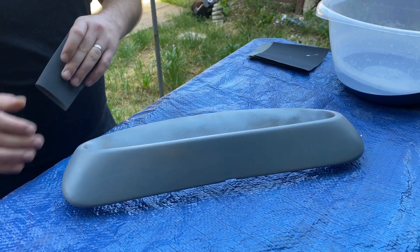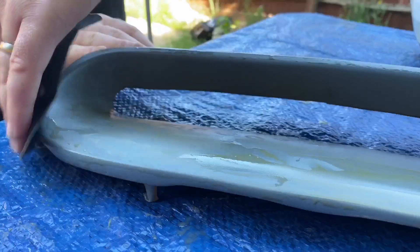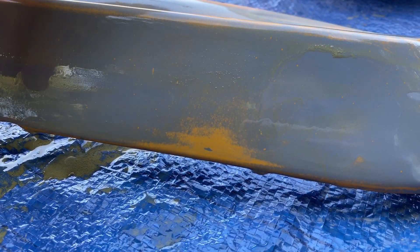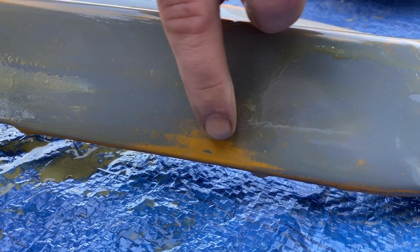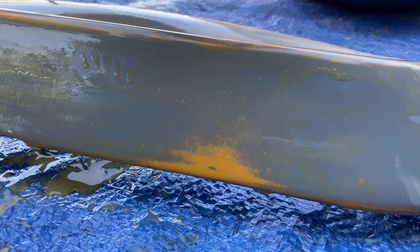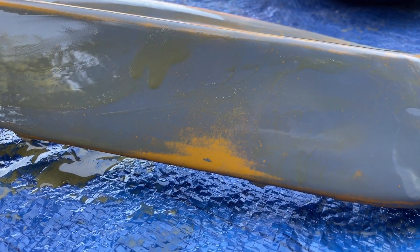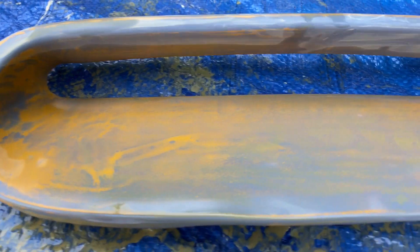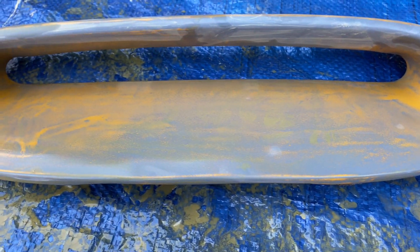You can see now why I've done a grey layer, then the yellow layer, then another grey over the top. Now I've sanded it down, that little grey spot in the middle is still the top layer of grey, but I've sanded around it to take the imperfection out and it's gone down to the yellow layer. When I go across that with sandpaper it'll be completely flat. The orange pieces showing through now are all the imperfections I've just sanded down, all nice and smooth. This is the last chance to take imperfections out, so we want it as smooth as possible. Then we're going to de-grease and de-wax it and get it ready for painting.